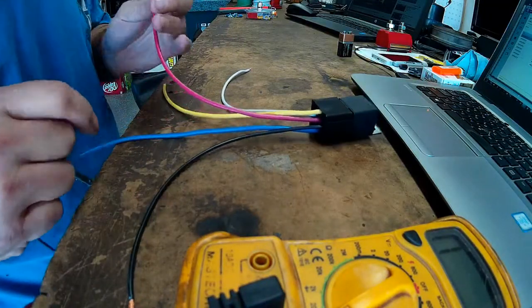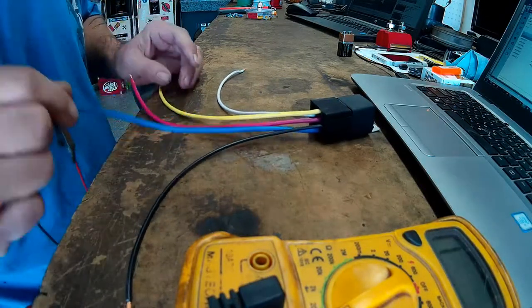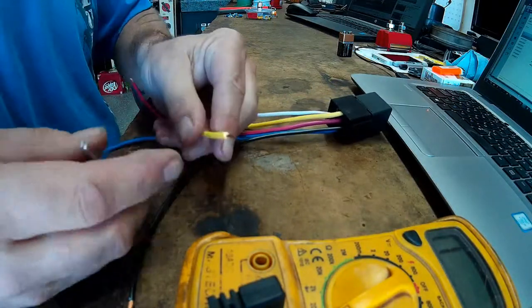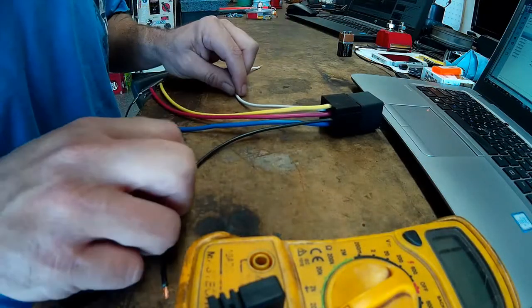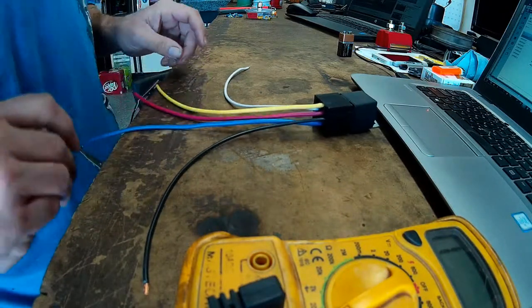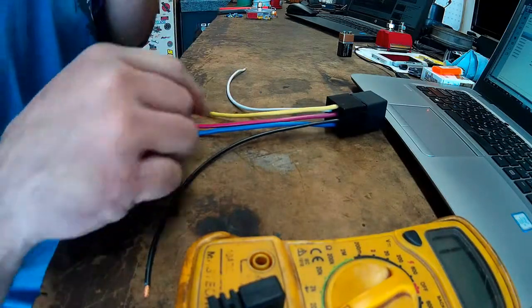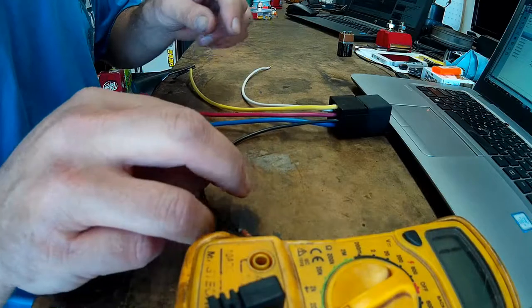So that means we normally have a continuous circuit between our 30 pin and our 87A. Now if I connect to our 87 pin, you get nothing. That's because the relay isn't energized, it's not triggered, so there's no power flowing between those two pins. Our power source in on our 30 pin and our power out to our device on our 87 circuit — there's nothing going on yet.